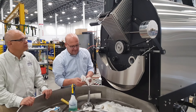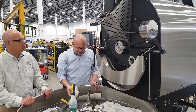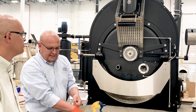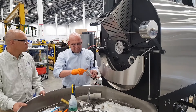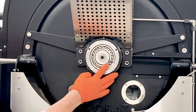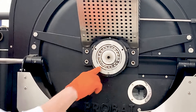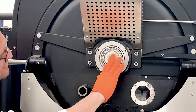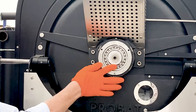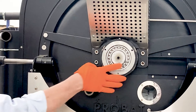By this time you should be getting clear solution coming out — that means it's clean, you stop. After you stop, you've got to dry it. What I like to do is grab a glove — I just like to grab a glove so I won't get my hands dirty. You have to pack the grease in, not just blob it. Grab it with your index finger and watch how I pack it in. You've got to really work it in between the ball bearing. If you get a lot of grease at the beginning, it's okay — just make sure you pack it in.